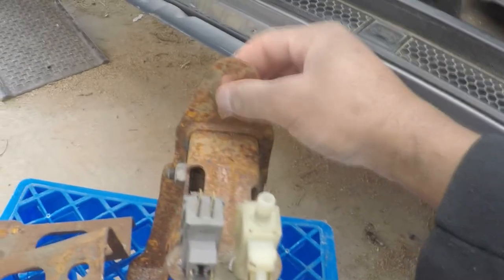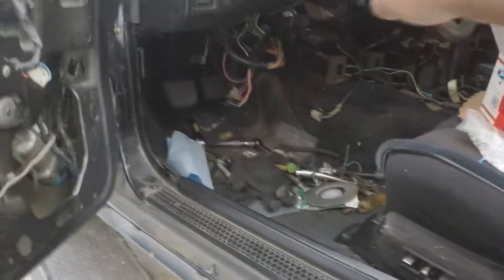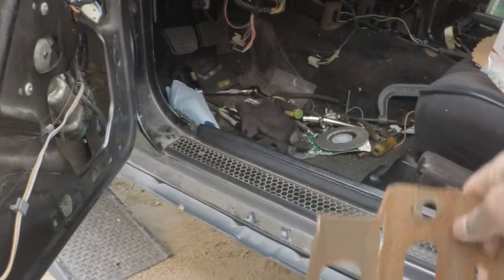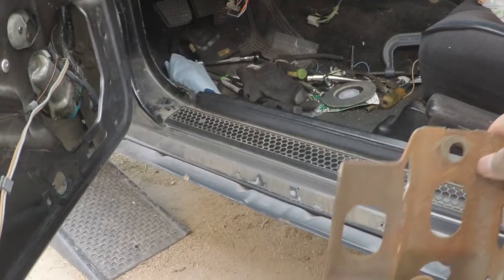As you can see, there's four holes that connect to the master cylinder back there with its nylon nut that's a 15 millimeter, and then there's going to be a top bolt hole that bolts in underneath the dash, behind and above the steering column a little bit, not right underneath the steering column, but to the side. It's going to be in the dash underneath like this, and this will basically bolt in like this. It's either like this or like this underneath. I don't remember. Either way it goes, when you put the new pedal on,